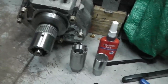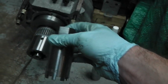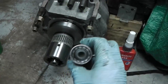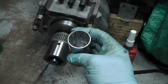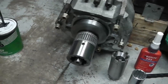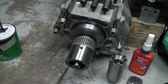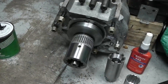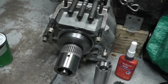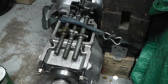This is the socket you need for the standard main shaft nut - Land Rover tool 600-300. This is a very nice H&J Engineering one, and this is the one provided with the Roma Drive: 27mm, which will also do your wheel nuts on a Series 3, so it's a much more standard item. I'm going to use some Loctite 243 on the grub screws - it's important to tighten them evenly as they lock the nut and lock this unit onto the main shaft. After that it's just going to be a case of reassembling the top cover to the gearbox with an appropriate sealant.